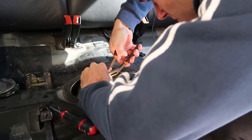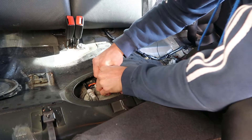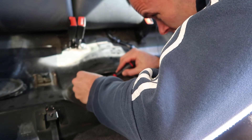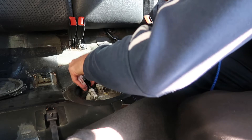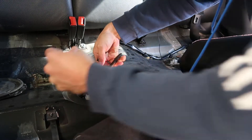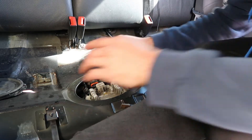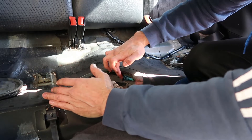It should pop out - it's half out. Damn, she's tight, she hasn't been off for a while. There she goes. These things are solid. Same again on this side. It's half out but it's tight the whole way. There we go. So blue's the pressure side going to the rail and the black one's the return to the tank. We're all undone. Obviously you want to try and keep them clean - normally if you've got your cap - but I don't have any caps.